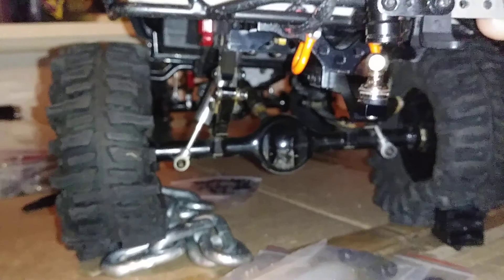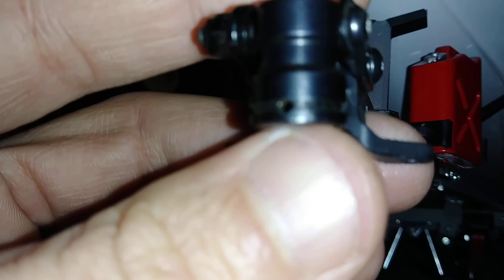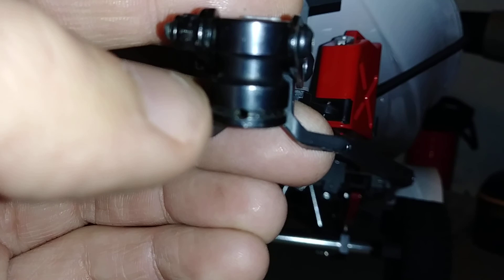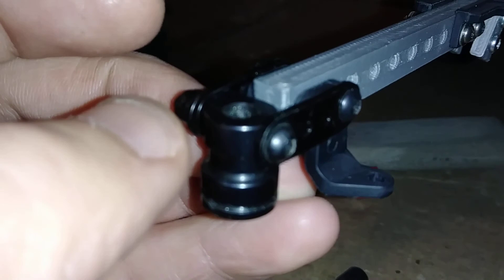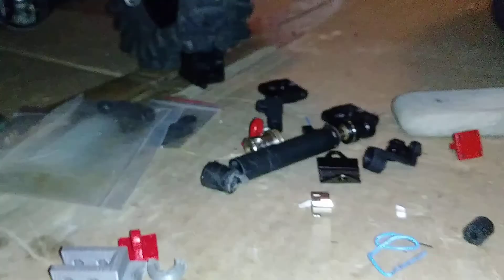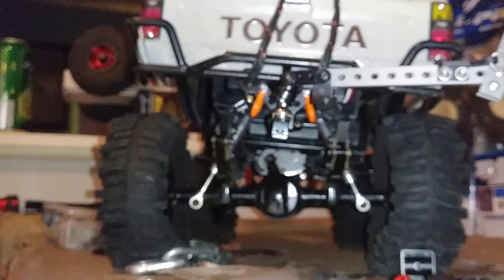Looking at the inside of the cup — there's a hole on the front and a hole on one side, but nothing on the other side. If I could get it to a drill press with cooling fluid, I could probably drill a hole through it, making it a little easier to hook things up going side to side versus front to back. Except this is like impact socket material. I had to drill out the top a little to accommodate the screw — it did thread in, but as soon as I hit the thread on the opposite side it got jammed, so I had to drill it out. I shattered the drill bit trying to go through this. So this is not aluminum; it's impact socket material.